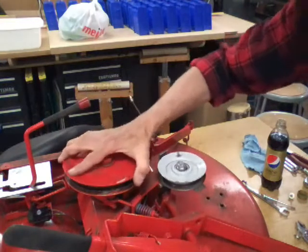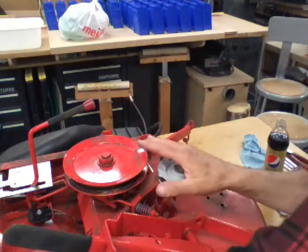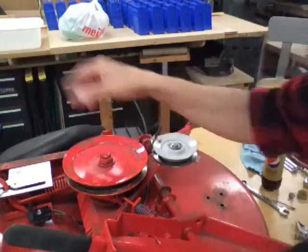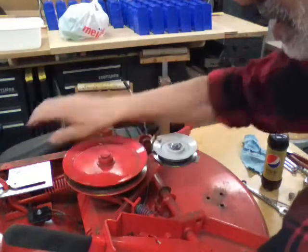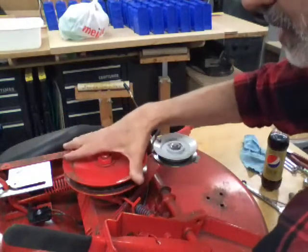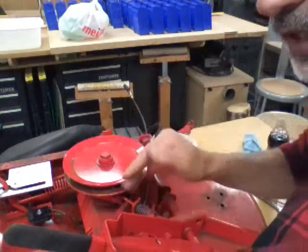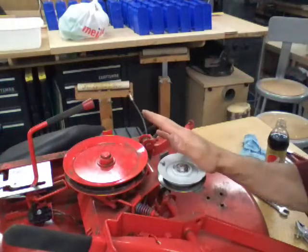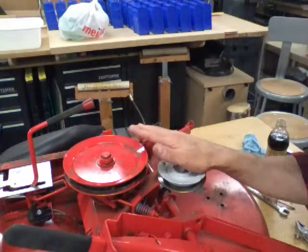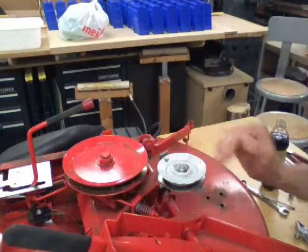Now your spindle. You can't turn your spindle because you have a brake on here, another safety thing, that stops the spindle when you let off on this pedal that you step on. You want to shift it in gear and hold that pedal down with your hand. Then you can turn your spindle. Now the noise you hear is the brake is dragging a little bit. It's not fully opening. But there is no side play. There's no end play. Even though they turn pretty free, I'm not going to worry about replacing them. I do have videos on replacing bearings and how to rebuild the spindle if you want to look them up. And that's about it. You can check your springs to make sure none of them are broke or come unhooked.